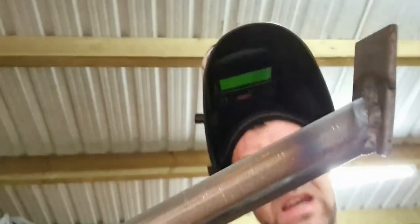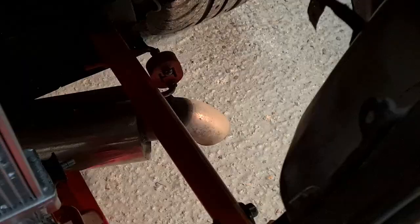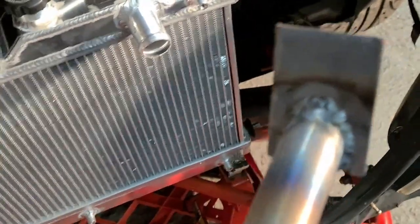Right, so I've made this leg, which will go off there up to the radiator on that bobbin. Obviously this foot, I'm going to drill a hole in it, that's for the bobbin to go through. I did think, if I have two male threaded bobbins each side, I'm not going to be able to fit the radiator in. Luckily I found a female one, so the idea will be I'll slot the rad onto the male one, put the nut on, and then I'll put a bolt into the female side, so it should just work. That's what's going on in my head right now.